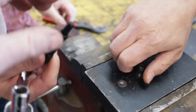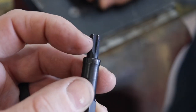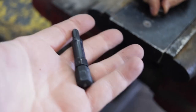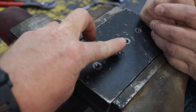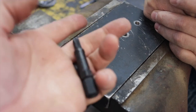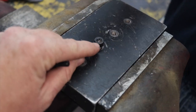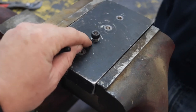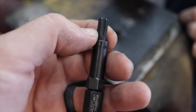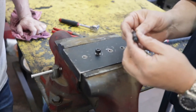That was a pretty good bite for very little depth. Obviously the head was broken off the bolt, it would be flush, you would drill a hole. It does have the drill bit sizes marked - indeed it does, on the foam tray. The seven-piece set has a drill bit index right on there, which takes the guesswork out of what drill bit to use. You want to drill out the bolt and drive this in as far as you can, because the deeper it is the more surface area it's going to grab.